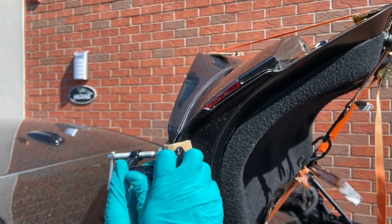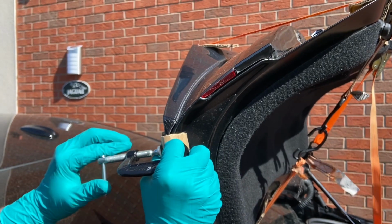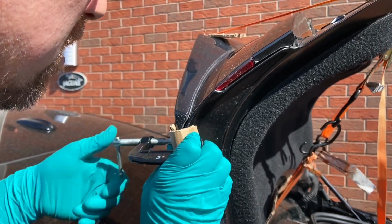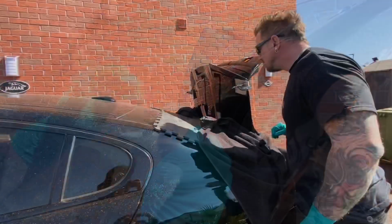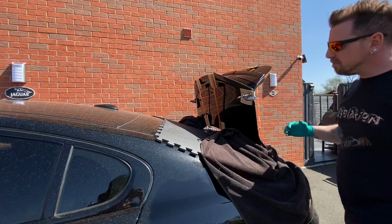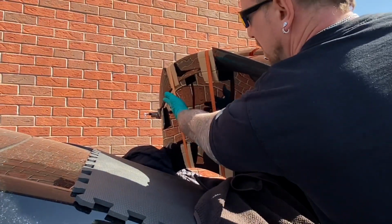I'm putting the floating head of the G-clamp on this side because this side is the angled side. And that's another reason why you can't really tighten up too much, because it's on a chamfered edge, so it's going to want to move away. I'm quite happy with this. Looking nice and flat. I'll see what it's like later, but that's clamped in position there. It's being held there, not too tight, like I said. The one there and another on the other side.